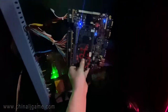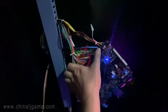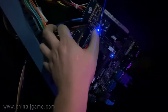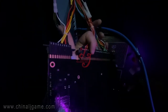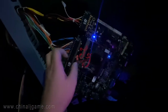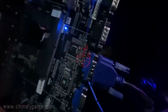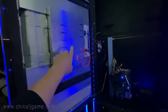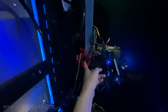There are a few interfaces. The first one is the harness — the 10 pins. You will see the labels here on the main board. There are blue lights flashing. On one side of the harness there are words, but the other side has no words, so you need to know how to connect the wires. This is the 36-pin harness connector. This cable is the VGA cable coming from the monitor. This is the power for the machine connected directly to 110 volts.